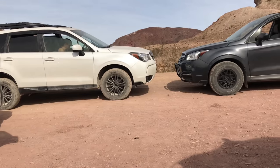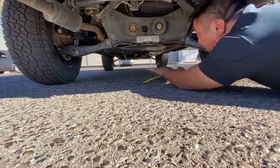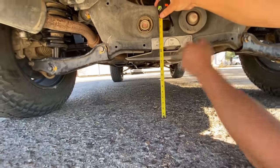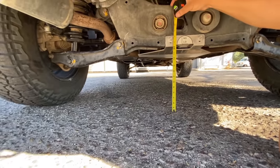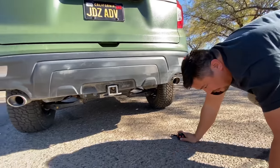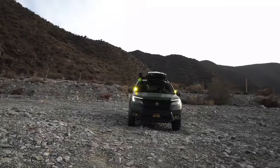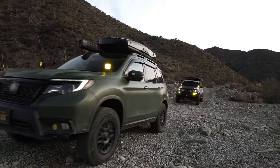That's a stock-height Forester to the right. The Honda Passport comes with 8.1 inches of minimum ground clearance. After the lift, it's over 12 inches — like 12 and a quarter, maybe 12 and 3 eighths. That's amazing. Even if it settles down lower, an even 12 is amazing. It's also 12 at the front and 12 inches measured in multiple spots. Now it's been a month and I have 3,000 miles on the new lift kit. I still have 12 inches at the front skid plate and 12 and a quarter at the rear diff.